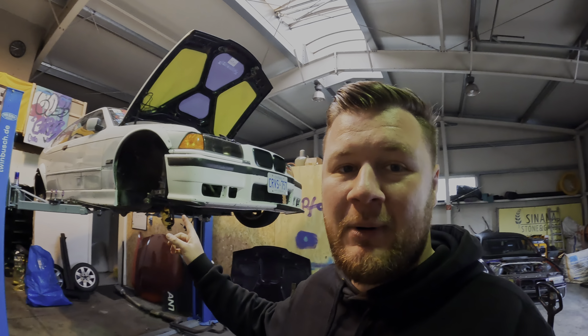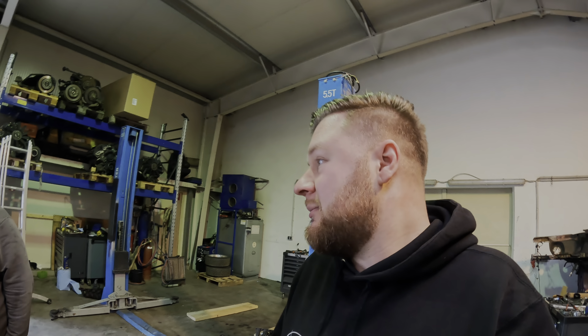The Mika is here, and our plan for the build is to repair the Achsschenkel and also of course get a little bit more power. We will do this with the help of this here - that is a M52 B25 with Vanos, which is better than an M52 B20. Theoretically with double the power - 190ps. With a little software tune, yes, on the way.